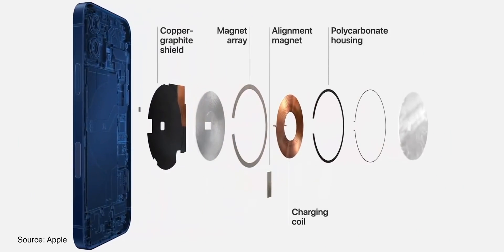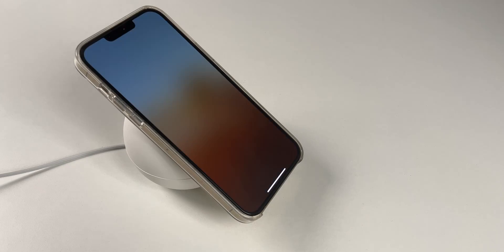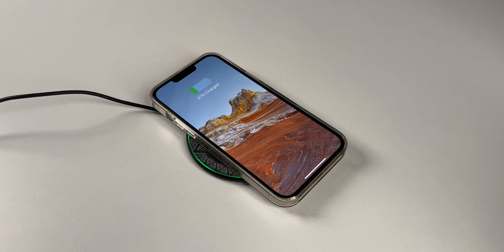How exactly does wireless charging work? There's a coil in the wireless charger and there's a coil on the back of your wireless charging compatible smartphone, and those two coils need to be aligned perfectly. The power transmission happens through electromagnetic induction. If the charger and the phone are aligned perfectly, you're going to see an LED indicator on the wireless charger, and your phone will actually start charging — which means your alignment is perfect and you're golden.